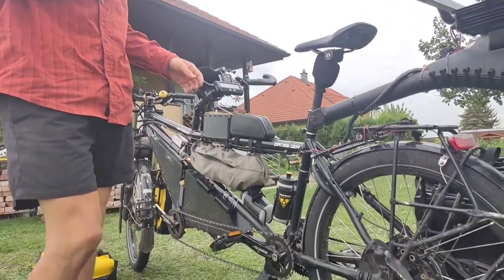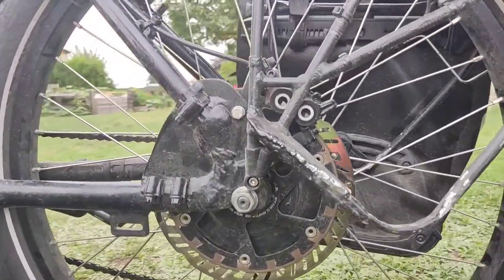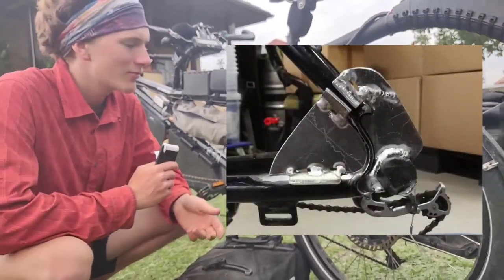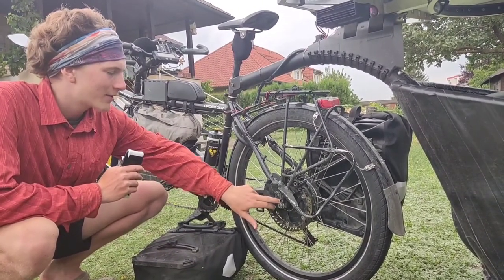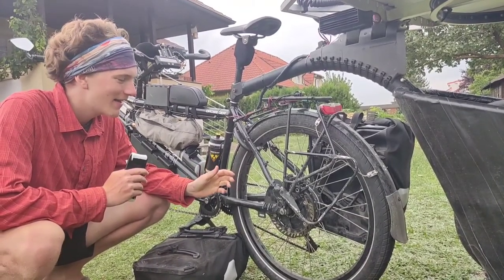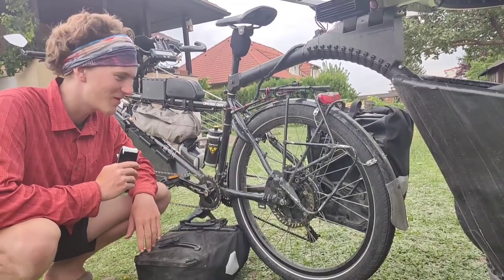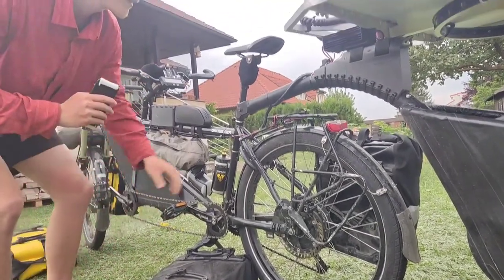Another modification is the frame — we put a lot of aluminum support in, welded and secured with hose clamps. We did that because we found reports of people traveling with a normal tandem bicycle — no solar, no electric — where the frame cracked in a similar area with a similar design. Additionally, we have torque on this axle from the hub motor, so this axle somehow needs to be supported. We put a lot of aluminum there to make it strong and hopefully survive this long journey.